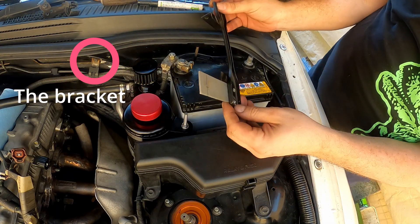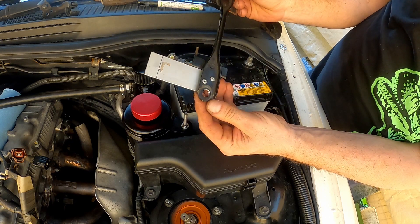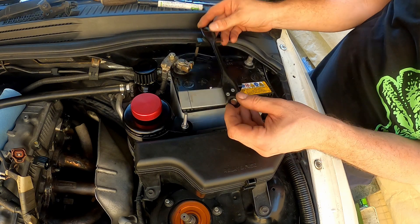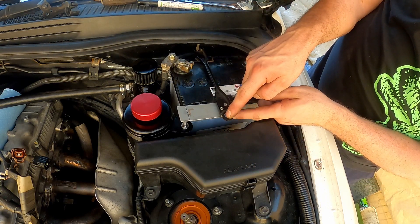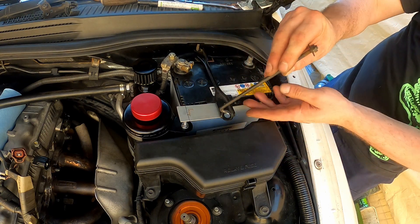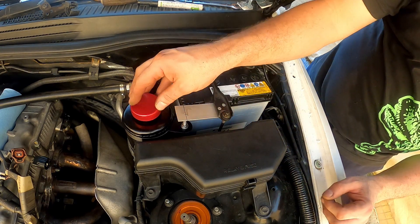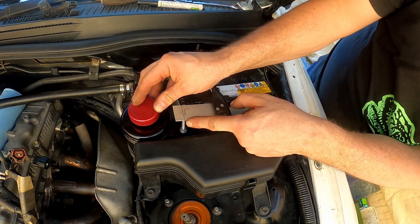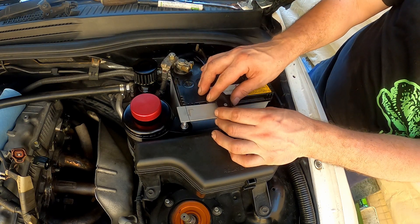I've had to come up with a bit of a unique solution for the battery stay. I've just riveted that on there — there's nothing complicated about that. Used a step drill to get that edge like that. That goes on there, to the pin that runs down there. Clips in there like that. I've just eyeballed this cross here, started off by finding out what the edge was with a marker, drew a line across, and then held it here and scratched the bottom of it.